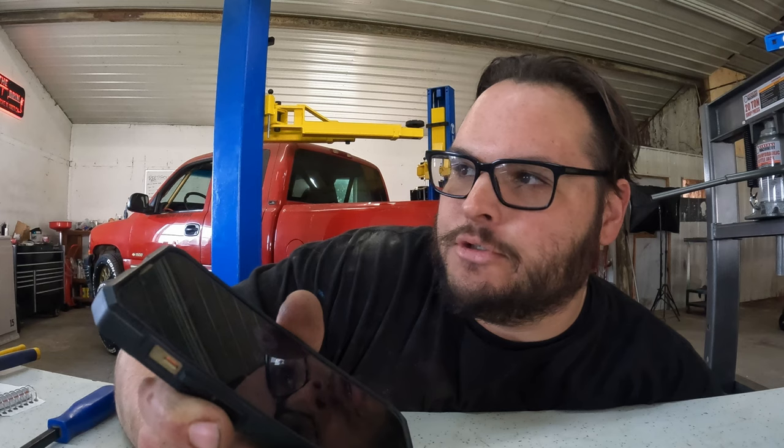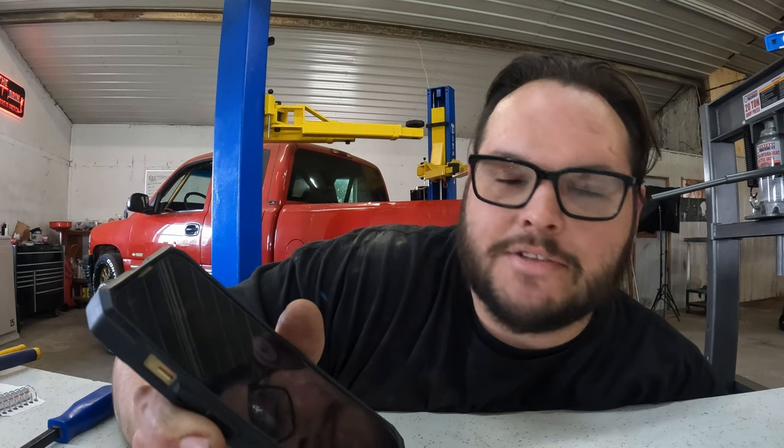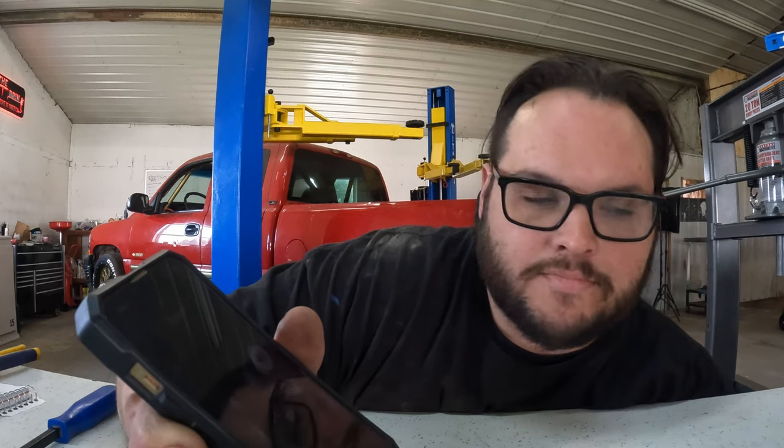Yeah, the measuring parts. Do you have these bearings lubed while you're measuring this stuff? We talked about that too. Right now, no. Definitely throw some lube in there and check it again. You might be okay. You not having lube on your bearings might be creating more friction, making your torque higher. You think it's 10 pounds? Inch pounds? It could be. Yeah, that's what I meant. All right, well, I'm going to try that and see where I get and figure out what I'm going to do.